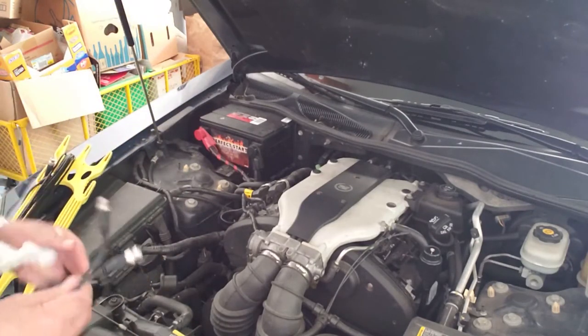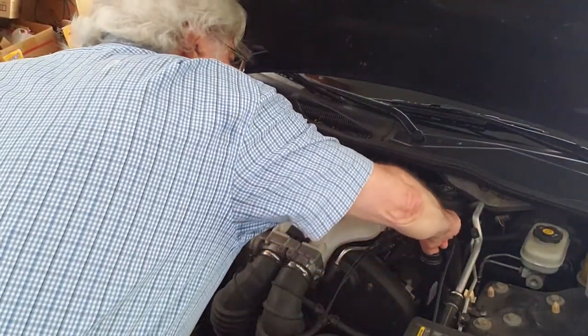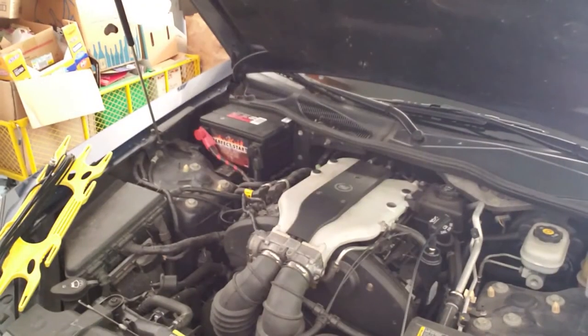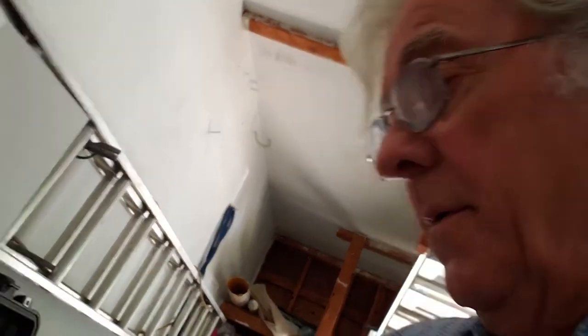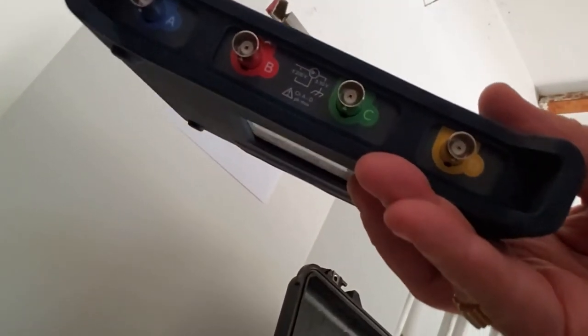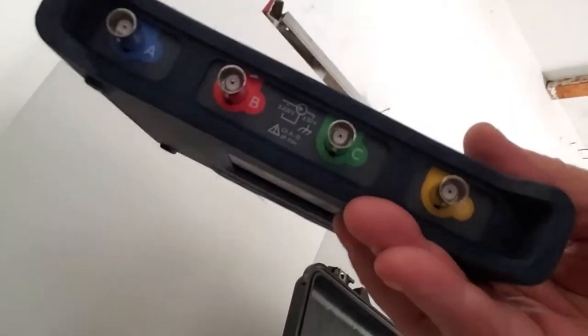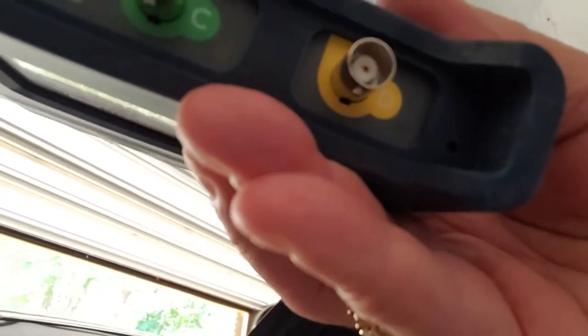Here's the BNC cable that we attach, and I like to connect the BNC cable to channel B. Next we will get the PicoScope out — what we have here is a four-channel scope. I'll put the crankcase sensor on channel B and I'm going to set this on the driver's side of the car, then hook the BNC cable to channel B as I mentioned.